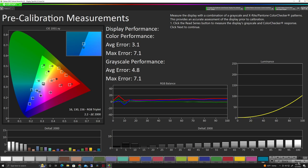Now let's move to the next screen. This screen is going to ask for a full DDC reset. By doing this, we're resetting any values you've put into your screen — any color calibrations put into the current setting you're working on, which would be SDR Bright. That will wipe those settings out, put it back to default, and then allows the system to build upon that. If you've got a bunch of settings in there that could affect your display, that could cause a problem.